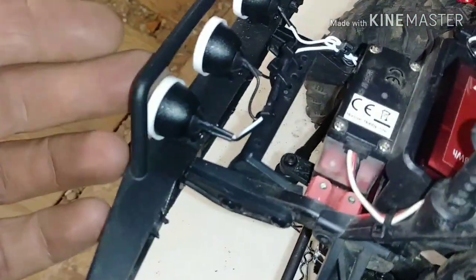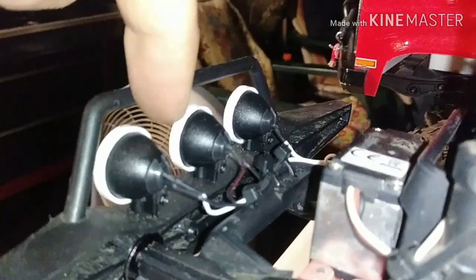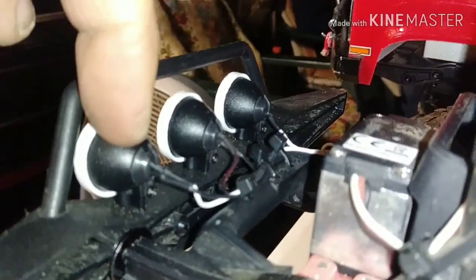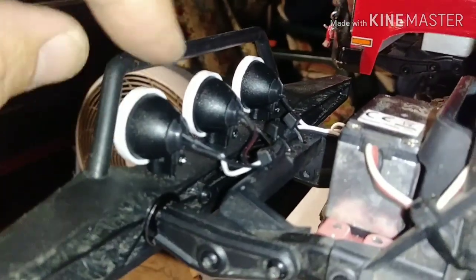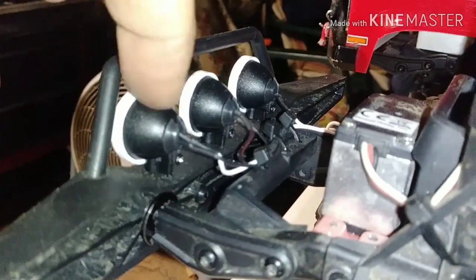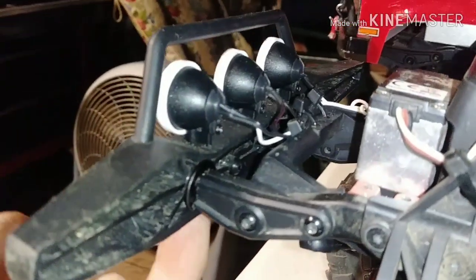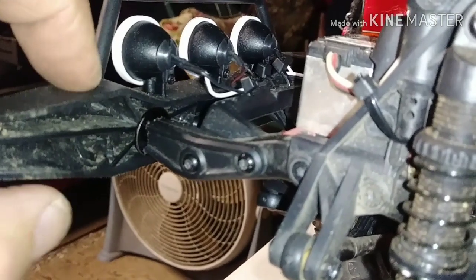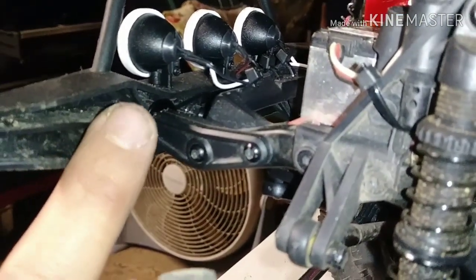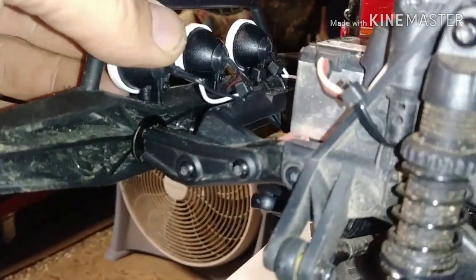One mental note about the lights on the bumper: the back of the bumper is heavily gusseted and very difficult to screw into. I basically marked out where they needed to be on the bumper, drilled through from the top down all the way straight down with the same size bit as my screw, then used a larger bit to come back up through that hole, stopping before I got up to the top layer of plastic. That way I could feed the screw in through the bottom through all those layers and still be able to bite on that last layer to hold the headlights in place.